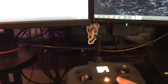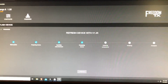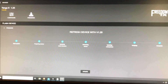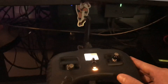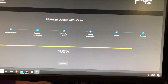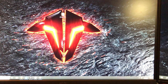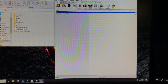The Tango 2 has restarted — just leave it alone. You'll see the menu pop up. Just leave it and let this flash continue and finish. The next thing is we're gonna do the SD card. We're gonna scroll down to the bottom option on your screen, which is gonna be USB Storage SD. Select that, and what we're gonna do next is we're gonna take those files that we downloaded — the SD card contents — and we're gonna unzip them. You do need some sort of unzip program.